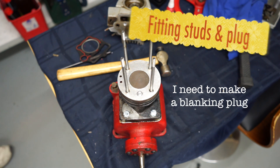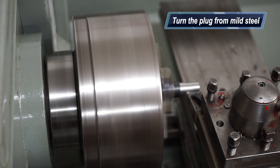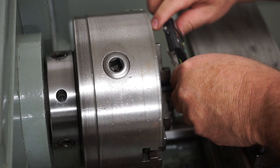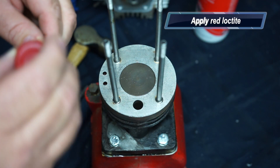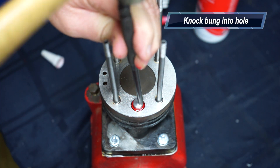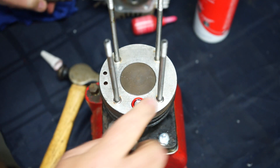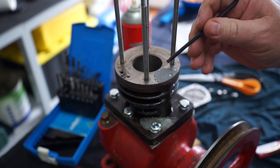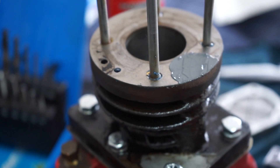What I need to do now is make a blanking plug that will go in that oil return line in the barrel, as this won't be needed now — I need to block it off for compression reasons. I'm applying some red Loctite to that bung I made and inserting it into the hole and driving it home. I accidentally hit a whisker below centre, so I topped it off with JB Weld and then scraped and filed it down to the right height later on — that's what gave me a good seal with the cylinder head gasket.